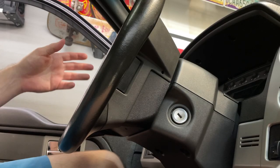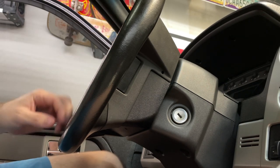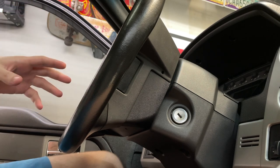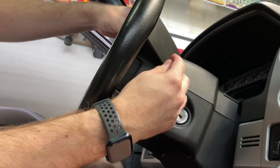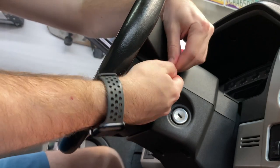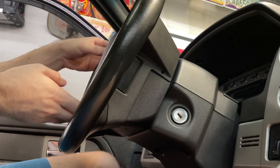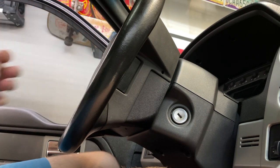It's about 30 seconds after I finished that last clip and I've already got two of the three points released. I wanted to show you this on camera — I've seen videos online where some of them made it look super hard, but in this case it's super easy. All I'm doing is sticking an Allen key in there, hitting the bottom right there and pushing it. You can see the airbag almost jumped off right there because I did the two releases, so the airbag is now loose.